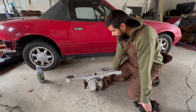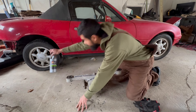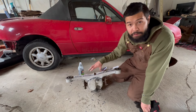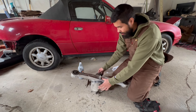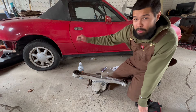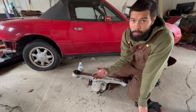I'm going to let the RTV dry before I put the fluid in. I just got the cheapest 75-90 gear oil they had at the parts store. General recap: there are failure points here. The major one is the welds inside. First of all, the gears are already weak — if I put super grippy tires on it, one clutch kick might strip the ring gear. That's already a flaw.